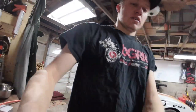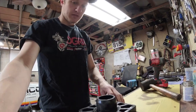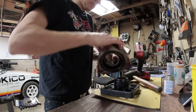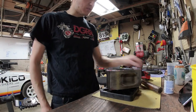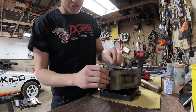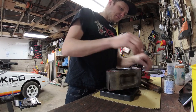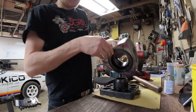We're going to grab our front rotor and put it on the stand. A little tip: take either new apex seals or an old one that fits and make sure all your corner seals and corner seal springs are perfectly straight. Go around and make sure the apex seal can slide perfectly down into the groove. Flip the rotor over and do the other side.